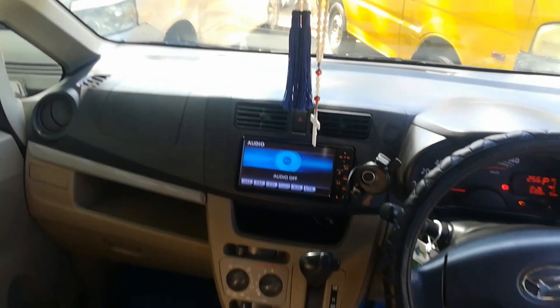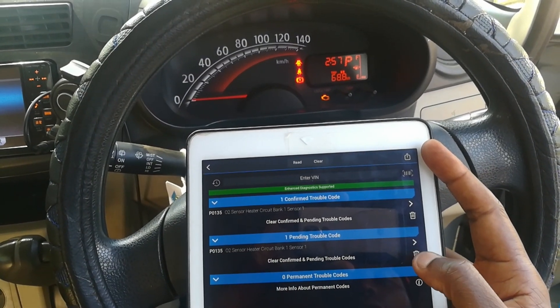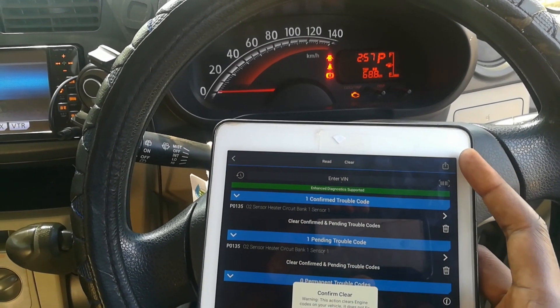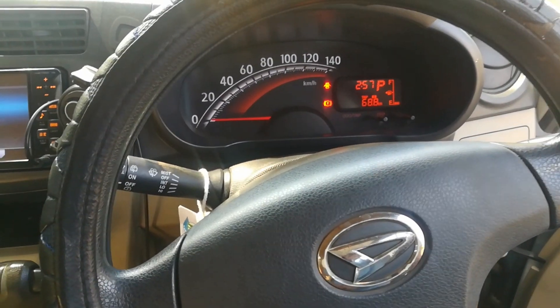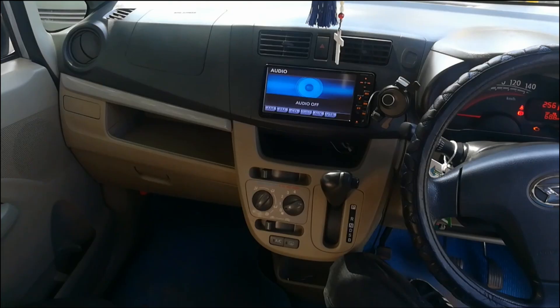That's why the check engine light is telling us the heater circuit is not continuous. We may go ahead and diagnose other issues with the heater circuit, but this is a good pointer — this vehicle needs a new oxygen sensor. I'll go ahead and clear these codes just to confirm that's what's causing the check engine light. Remember: deleting the codes or turning off the MIL light does not solve the problem. We need a new O2 sensor or air-fuel ratio sensor, otherwise the check engine light will come back and the vehicle will continue to have poor fuel mileage. If you like this content, kindly consider subscribing, liking, and sharing. Thank you.